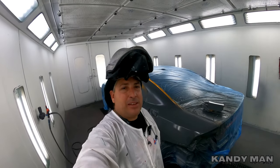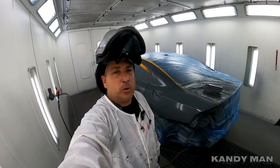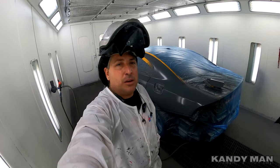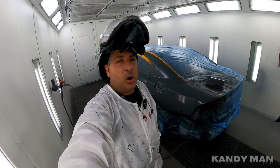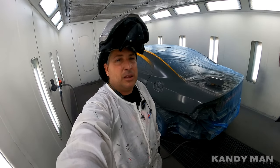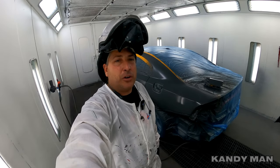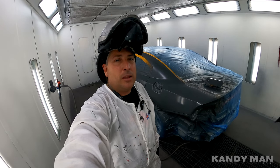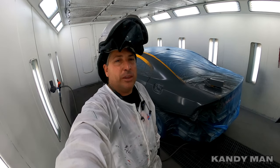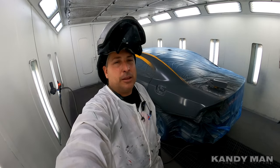All right, so we're all based out. I got two coats on there, and this is the Ultra 9 water base from Sherwin-Williams. So this is that ceramic gray. And we're gonna be trying out that new gun for the clear too, because I know it's got the same consistency as an actual clear coat, being it's made for the sealer. And just don't go and try any gun out for your clear. Make sure you got at least a 1.4 for the fluid tip. Don't go any higher than that and try to clear with it because you'll have problems. I'm only trying this because I know it's a 1.4 and I know it'll work, but let's try it out.